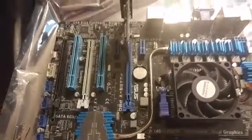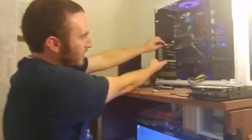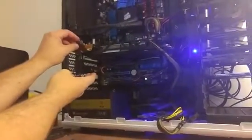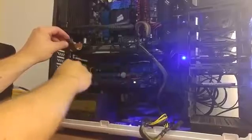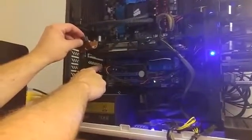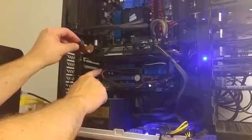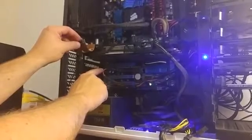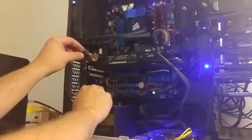Let's go ahead and put this in a real machine and I'll show you what kind of results we get. You can see it's in the machine, and as I said earlier, it's a very small footprint — there's really nothing to it. The only unfortunate part is make sure that you have a SATA power so that it's powered. I thought it would be powered enough by the PCI Express slot, but it wasn't, so I had to put in the SATA power in order to get it to work. The good thing is I'm running Windows 10 and I did not need to install any drivers — it just found it, knew exactly what it was, and totally works.